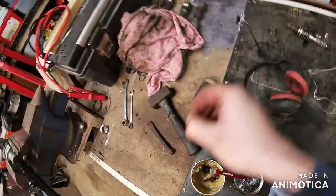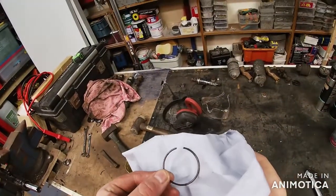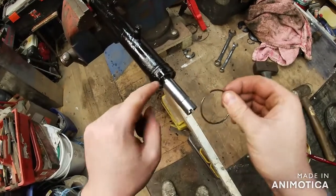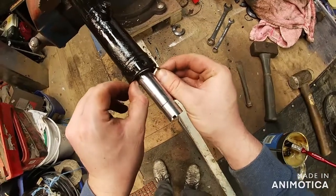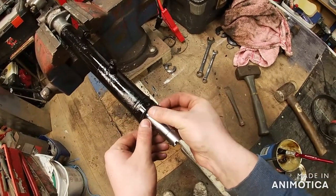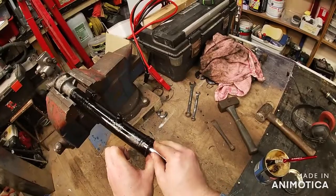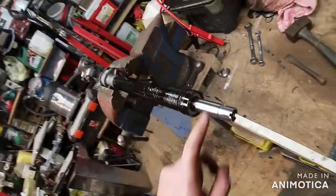Holding that in is this little metal ring here - that just clips into the groove. I'll show you that. You want this joint to be where this little hole in the rack is, because then you can put a screwdriver through the hole to get this clip out in the future. Well, it's not the sort of thing you need to be getting out all the time, so it's just a case of easing that clip in. There we go, so that's in - that's this side done.